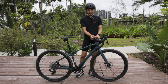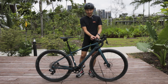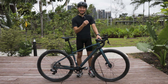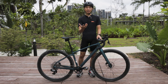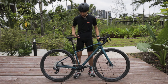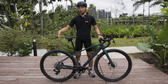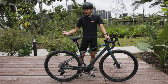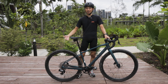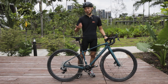The second thing is about the stem length. We've got a 50mm stem here, which looks a bit short. This is something personal, but I feel you should have minimally around 90mm to be sufficient — that's just my preference. Finally, while there are many mounting points all over the frame, the introduction of a dropper post means you have to sacrifice having big chunky saddle bags. To counter that, you have to choose alternatives such as a pannier rack at the back — just some adjustments you have to make to live with this beautiful dropper post.